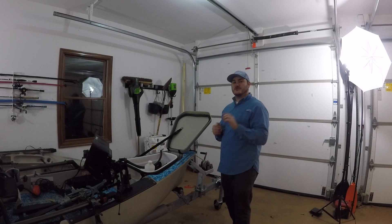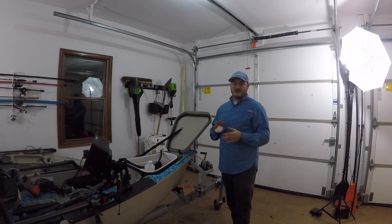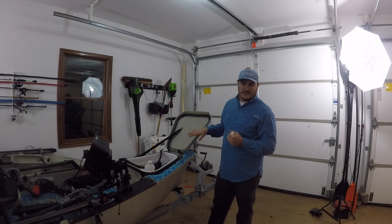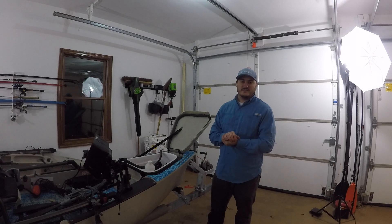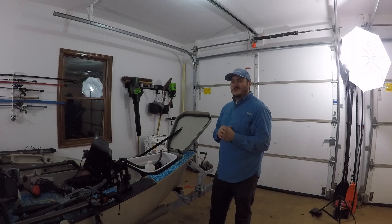I hope you enjoyed it and I hope this was helpful. If this is something you're looking to do, it's really easy and it's not that expensive at $15. There are a lot of people complaining about the front hatches leaking, especially in salt water when you're going through waves. For $15 and less than 15 minutes, you can have it sealed up just like the new 2018's and completely waterproof your front hatch. I'll see you guys in the next one.